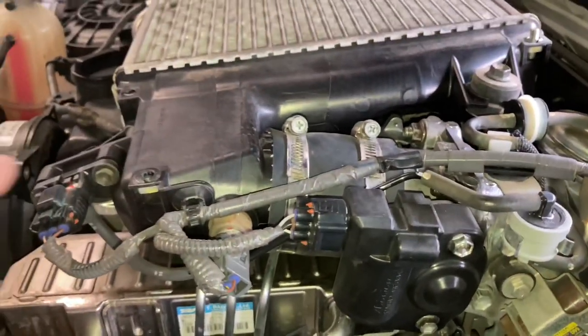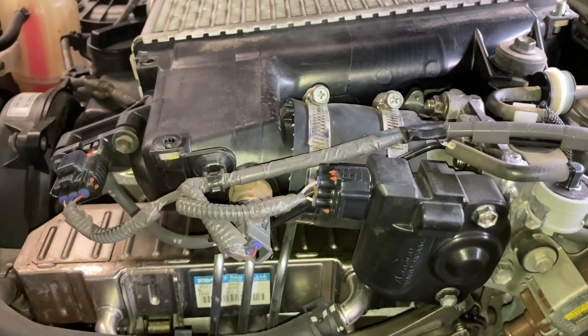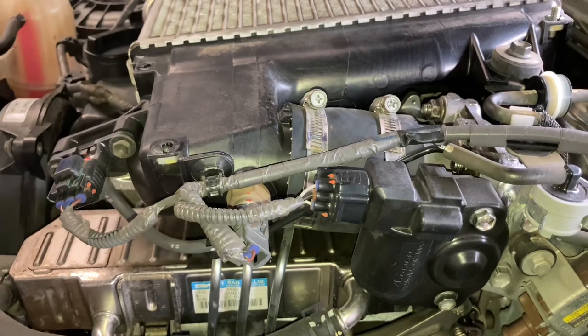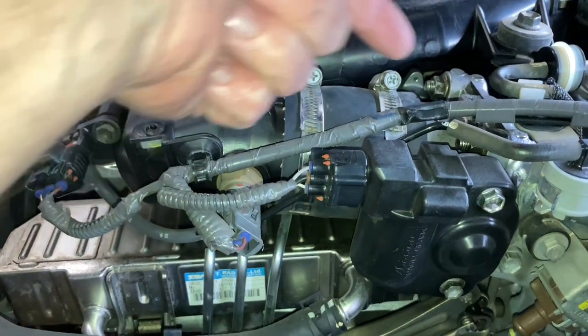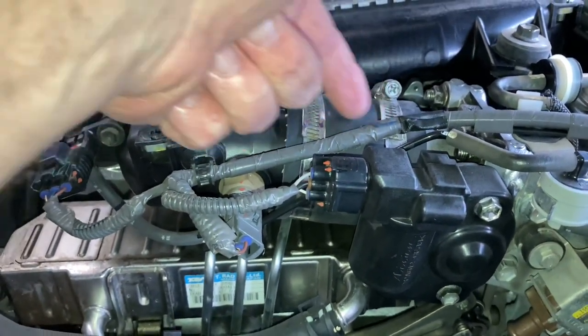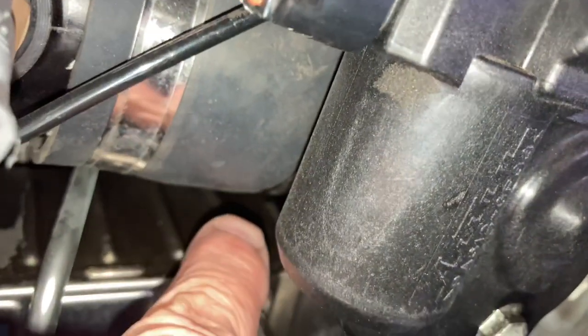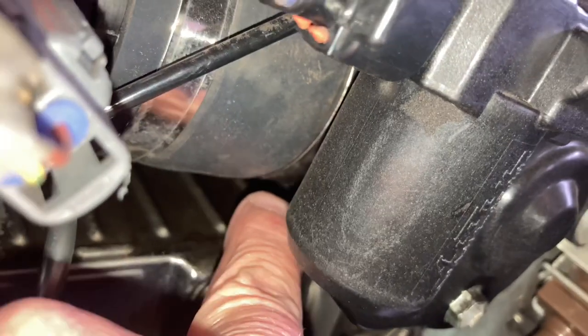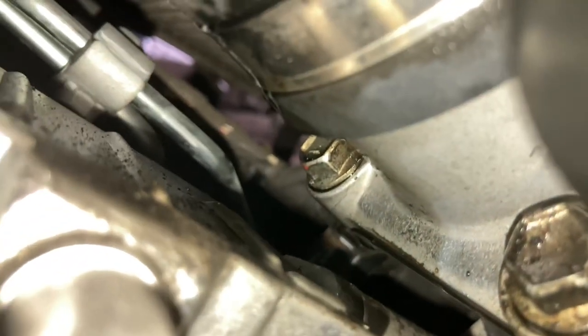I just think it's the slightest bit not tight enough. You've got your small amount of oil in your intake — everybody understanding engine breathing, the crankcase ventilation system — you get a small amount of oil in the intake, that's fine. But where it accumulates, it comes through the intercooler and there's a lip between these two joins — like a swimming pool at the bottom. If oil is constantly sitting in this boot here and it's not quite tight enough, it's going to run past that clamp. You can see the drip there — it's dripping onto the EGR cooler, and being parked slightly nose down it's slowly making its way around.